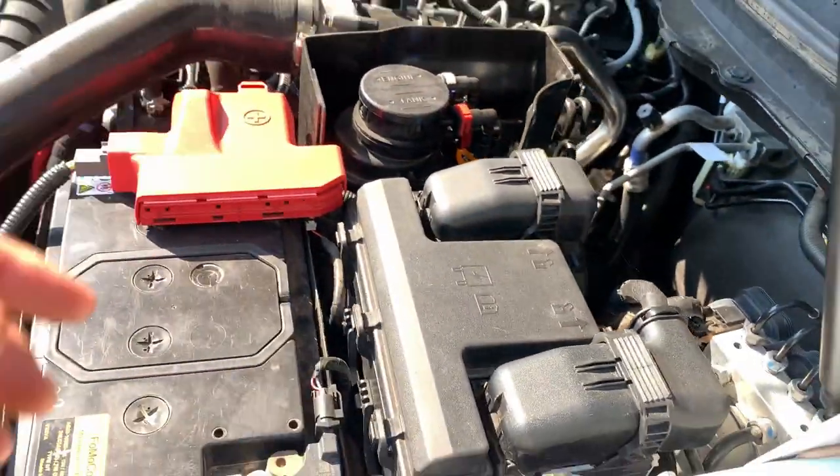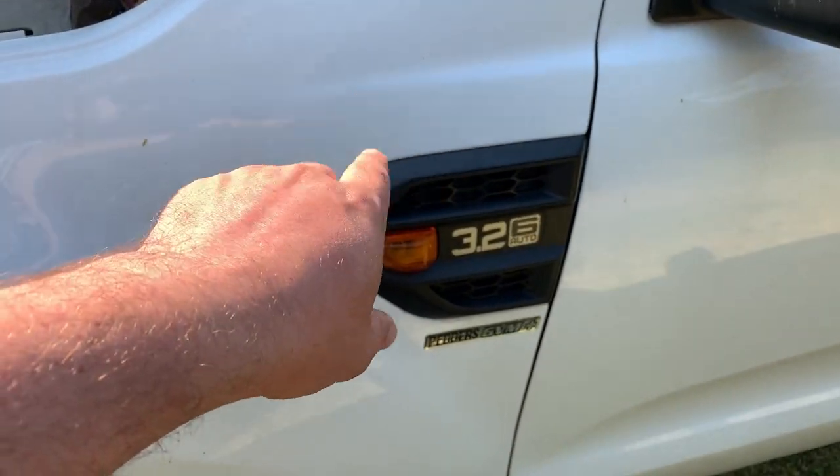I've run a big power cable from here through a grommet down inside the car behind the glove box. I've got two sections that break out off that cable - one is unswitched and the other is switched off the accessories. My UHF radio is unswitched so I can run it even if the car's not on. Things like the dash cam are switched. That's really all the power mods I've done - I haven't gone too hectic on it.